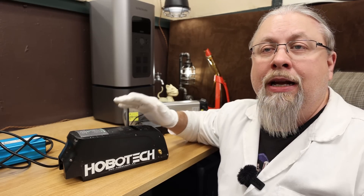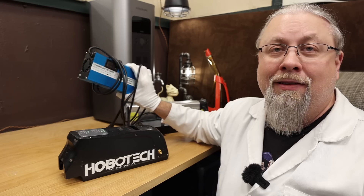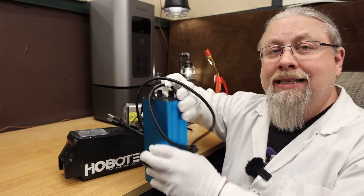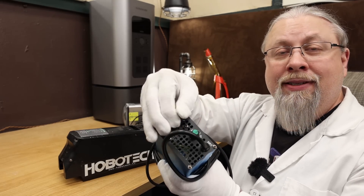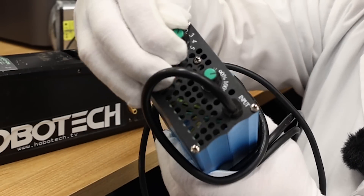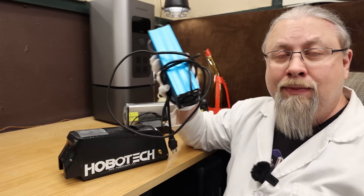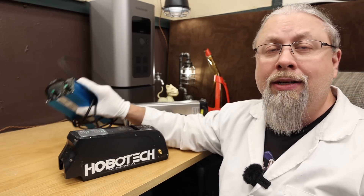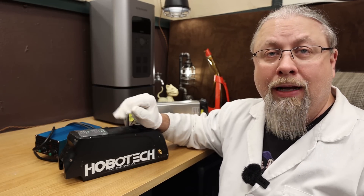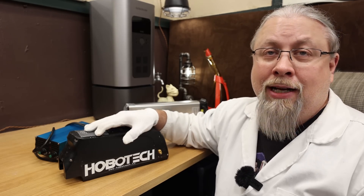How is this battery different? Well, it's really not — I paid an extra hundred bucks for the charger. This is a customized advanced charger that allows you to select amps and how much you want to charge your battery: 80, 90, or 100 percent. It allows you to adjust from one to five amps, so it's fully adjustable. To me this was worth its weight in gold, because it lets me either slow charge the battery to extend its life, or if I'm doing a lot of riding back to back, I can put it on five amps and charge this thing up in about two hours.